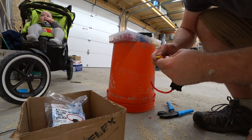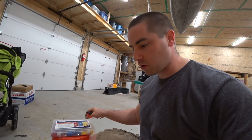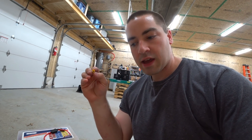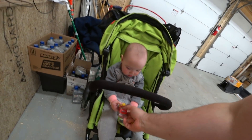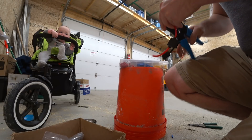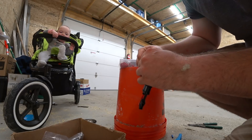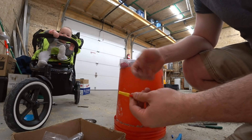Well, that didn't hold. My cheap variety pack of terminals — the splices weren't working and it just pulled right off. I noticed it had thin metal on the inside and looked like a larger diameter. That variety pack I've had for a while. So I went out to the store and got some proper ones. They're Dorman brand, and those are holding much better.